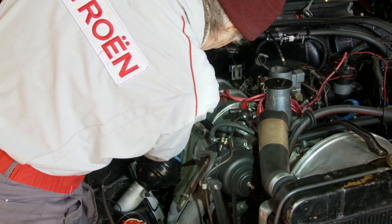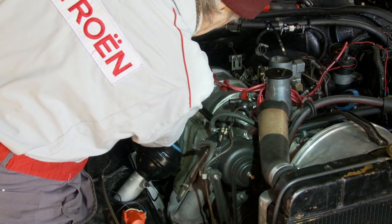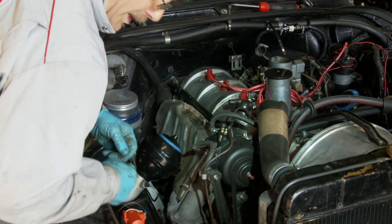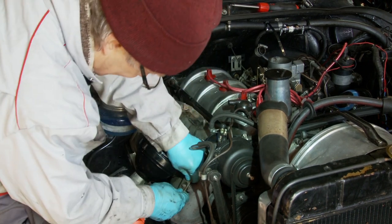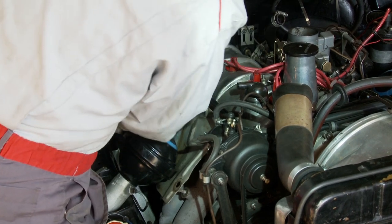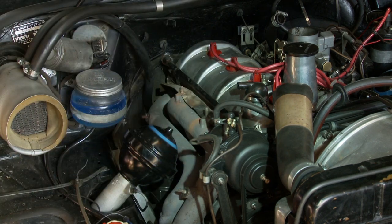As we're pulling the engine and gearbox out entirely, it doesn't matter as much here since we'll have access to the exhaust manifold anyway. In this instance the nuts are all coming off quite easily, though I will replace them with stainless ones on reassembly. You may have to be slightly forceful with the heat shield to get it over the studs as it distorts over time. Work it up and away — heat shield off.